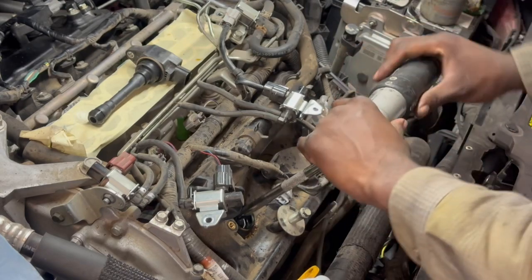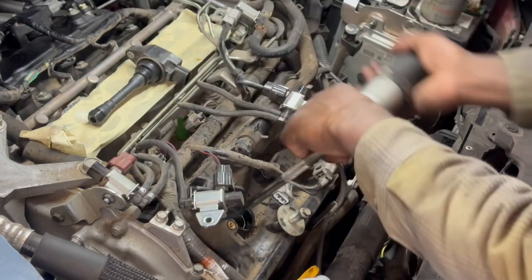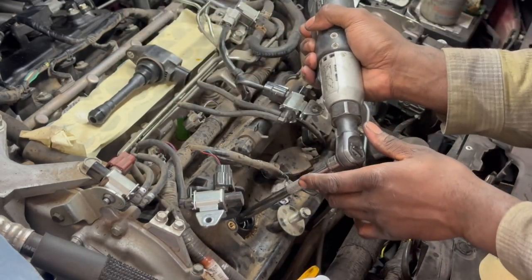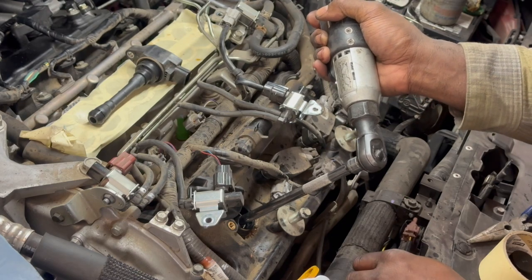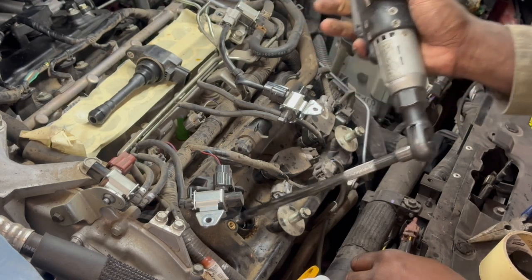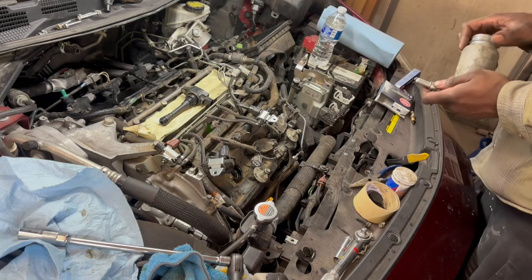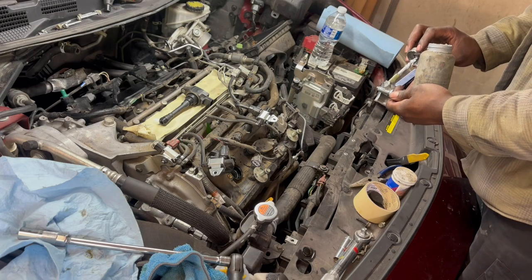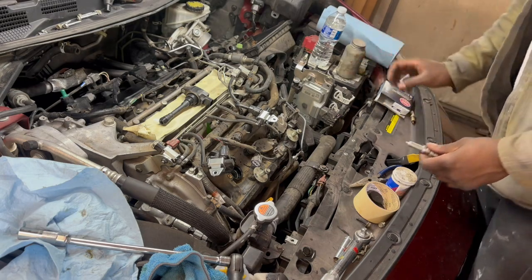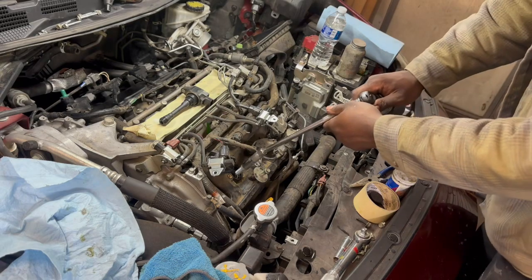Now here I'm doing the front end — this one right here is definitely child's play. This little clip gave me just a little trouble, but as long as you're persistent it will fold. We got that coil out, and just break loose the spark plug, pull it out with the ratchet, speed it up. Here's the new one — putting anti-seize on it out of the box, putting it back in the block.